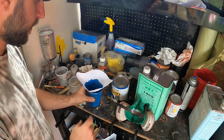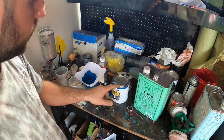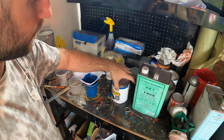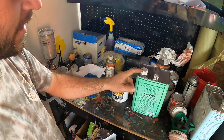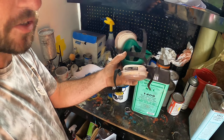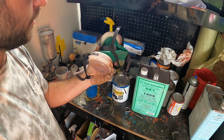Alright, I think that's good enough. That's already welded itself together and looks pretty solid, so I'm thinking after we paint that this thing will look beautiful. We're ready to paint. I got my paint mixed up and in the gun. Another thing that's nice about this Rust-Oleum — it's really thick, so I usually split it 50-50 with enamel reducer and put a little bit of enamel hardener in it. Never had a problem doing that. You end up with twice as much paint. It's about 25 bucks a gallon. Alright, I got my mask — I guess if you stay six feet away you don't have to wear the mask, but I'm going to wear mine anyway. Let's try that rust spot out first and we'll see how that comes out — show quality.